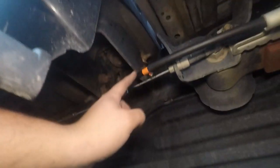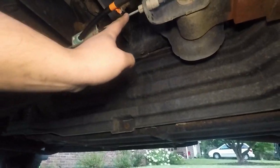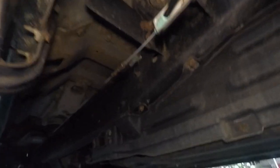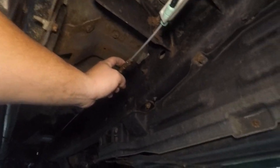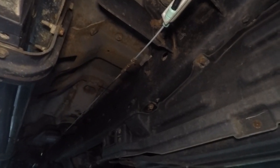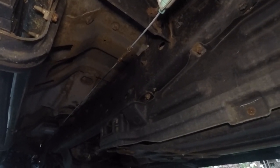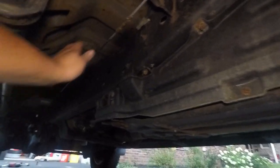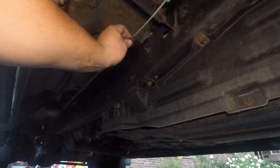The new hose already comes connected on this side, so this is to the passenger side. I did need to grab a hand to make this connection happen — basically I had somebody pull up on the emergency brake release lever, and then I was able to pull from that side down and make this connection. It just sits in there. Now that is all hooked together. If you guys have any questions let me know — I can shoot another video or explain it down in the comment section.